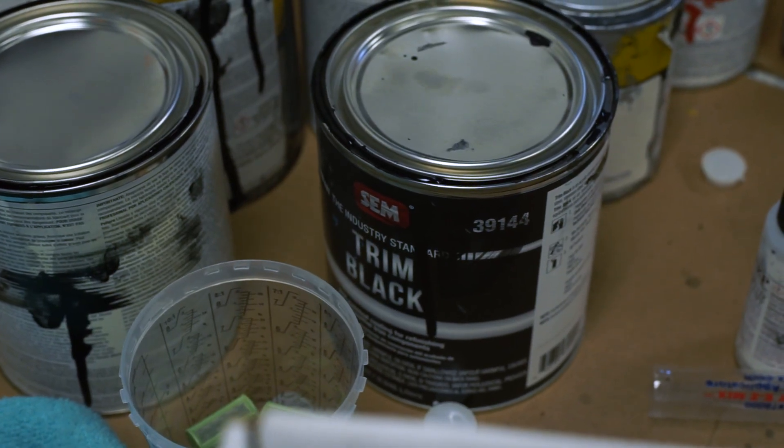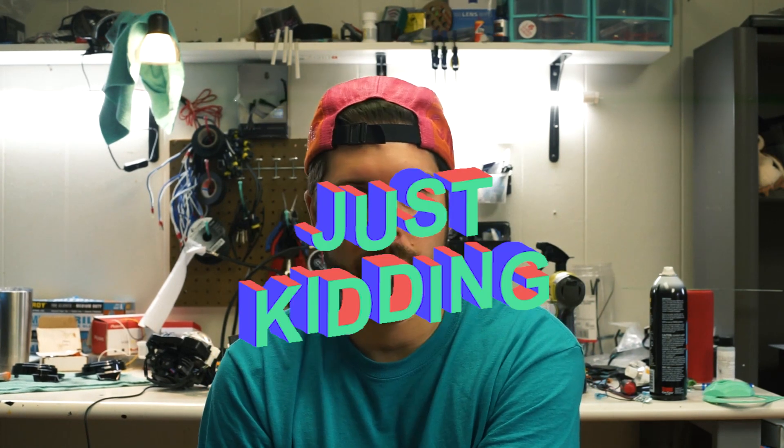So we wanted to add some color to it and darken it a bit. But if we painted it, the paint might be too thick for the holes we drilled, and clear coat could also kill some of the details and curves in that plastic part. So we wanted to keep it as light as possible. I actually tried to dye the plastic — a new venture for us. We gave it a shot with dye and hot water but it didn't stick at all; it just turned out pink. With a little more research, we found we needed to add a carrier, so we used 90% IPA with the dye mix and it looks awesome.